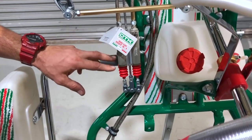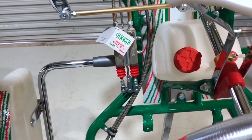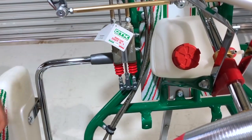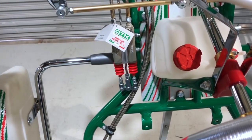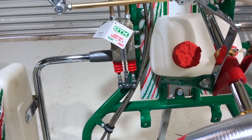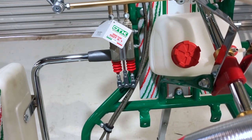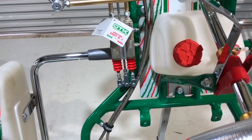This is the Tony Kart brake system — it's unchanged for a few years because it is so good. The only thing new this year is the DOT 5.1 brake fluid. Some older systems ran the 5.0 silicon fluid, which is not compatible with other fluids. Tony Kart have changed it over to DOT 5.1, which is compatible with DOT 4 and some lower grade brake fluids. Use the genuine Tony Kart fluid and you'll have no problems.